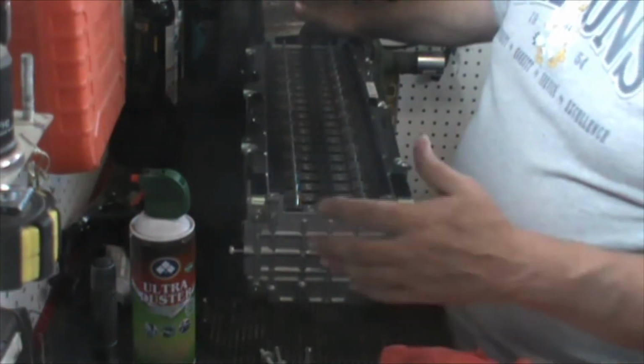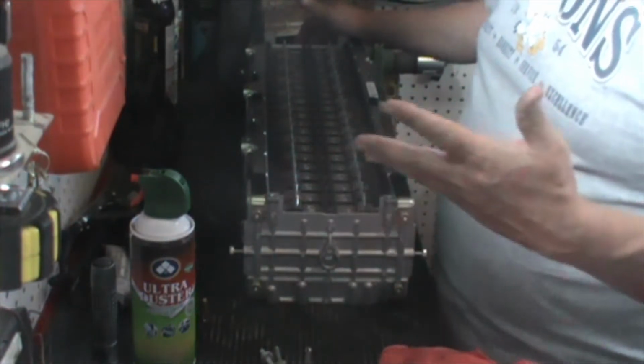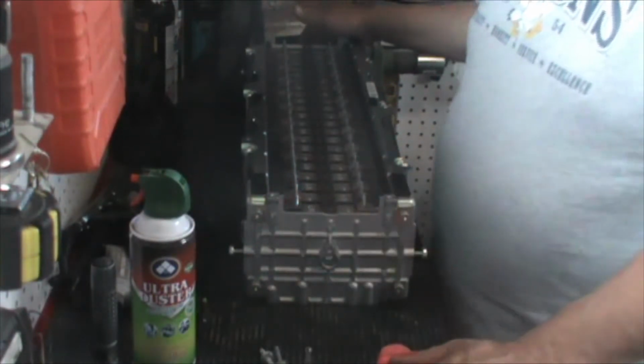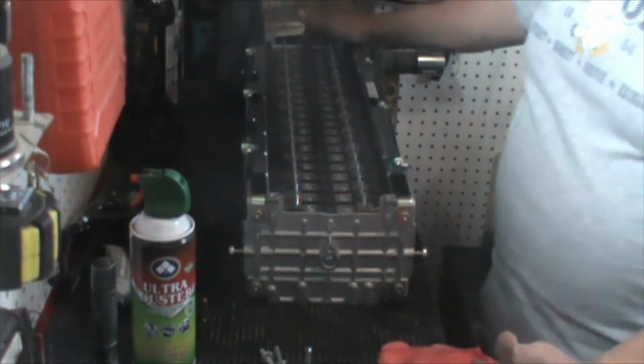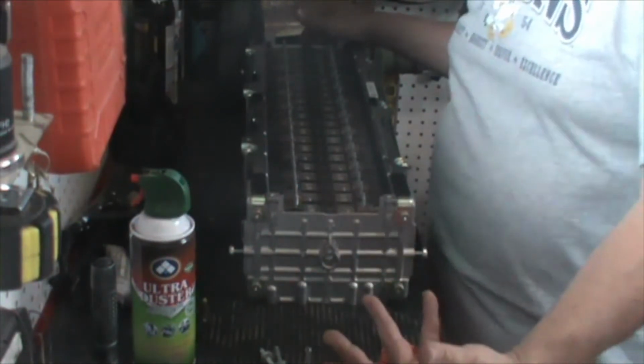In this case, we have 4 stamped compression bars with aluminum end plates. And this is designed by engineers to combat a problem that is known. So I generally recommend, if people ask me all the time, I'm building my own battery system, do I need to do a compression bar system? And my general response is yes.